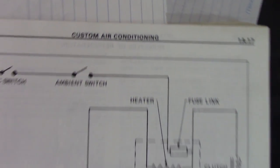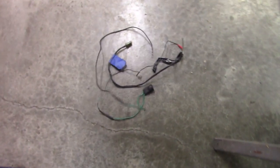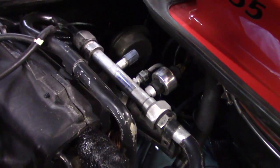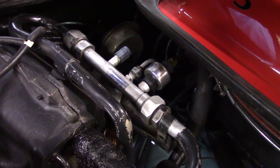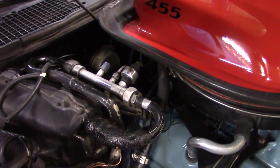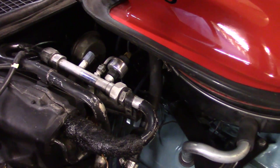Not much on the regular schematic, but flipping over to the air conditioning section there's a little bit on the wiring. So if you recall, that original wiring was pretty hacked up - I think this end was melted on here. Someone had replaced this, I believe it's called a POA valve, with this aftermarket job. And this thing cycles the compressor. From what I've read, this is actually a step backwards, but I'm no air conditioning expert. This is what we've got on the car right now, so this is what we're going to try to make work.